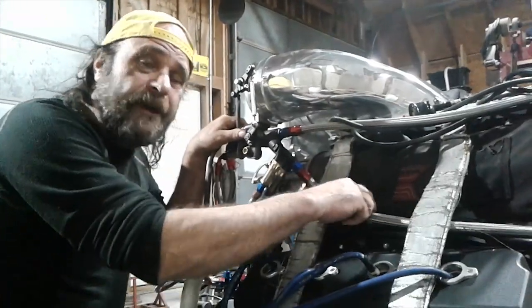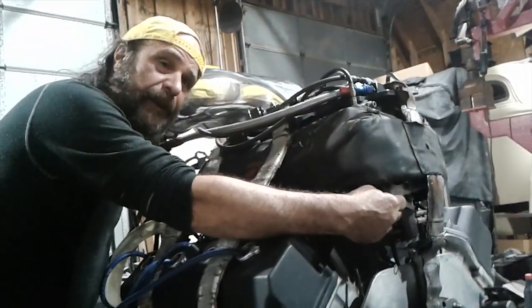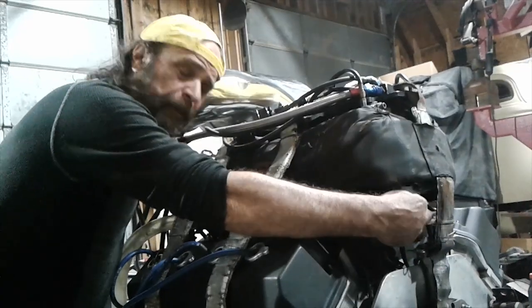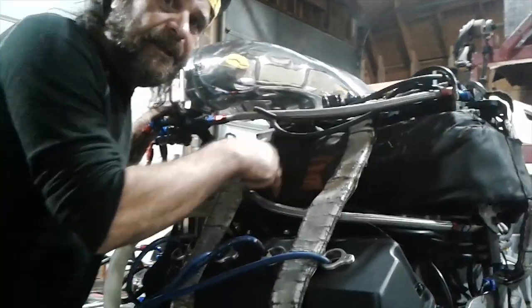This is the port line — it's the more important of the two. It sends fuel back here to this metering block. There's also a check valve here that keeps the fuel held back until the pressure comes up. From this metering block, it goes to these port nozzles, and this is where most of the tuning is done on one of these engines.